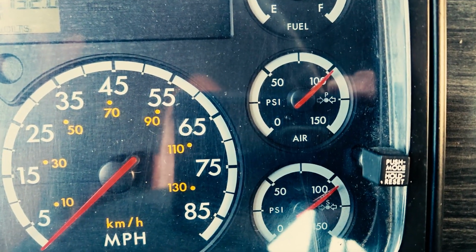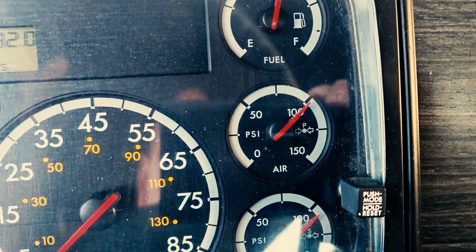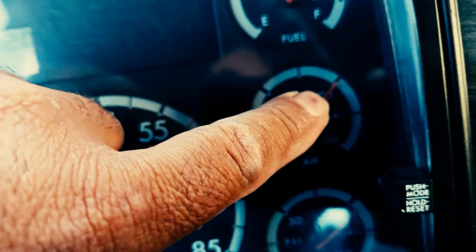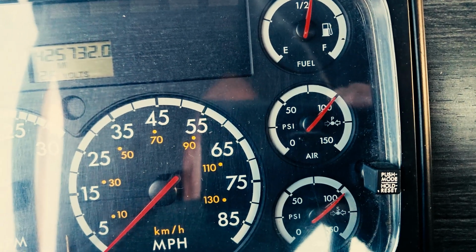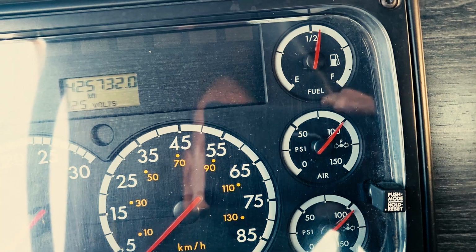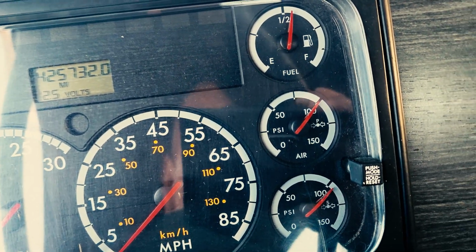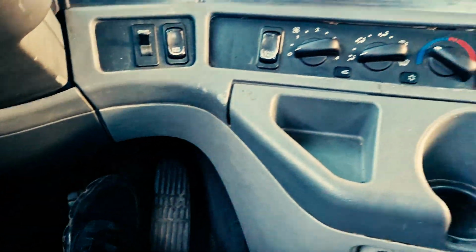60 seconds. Now at the end of 60 seconds, I will not release my service brake. I will first take the reading, which I'm taking note here. I have only lost 1 psi in the period of 1 minute. So I will tell my examiner, at the end of 60 seconds, as you can see, my vehicle did not lose more than 4 psi in the period of 1 minute. This vehicle passed. Now you may release your service brake pedal at this time.